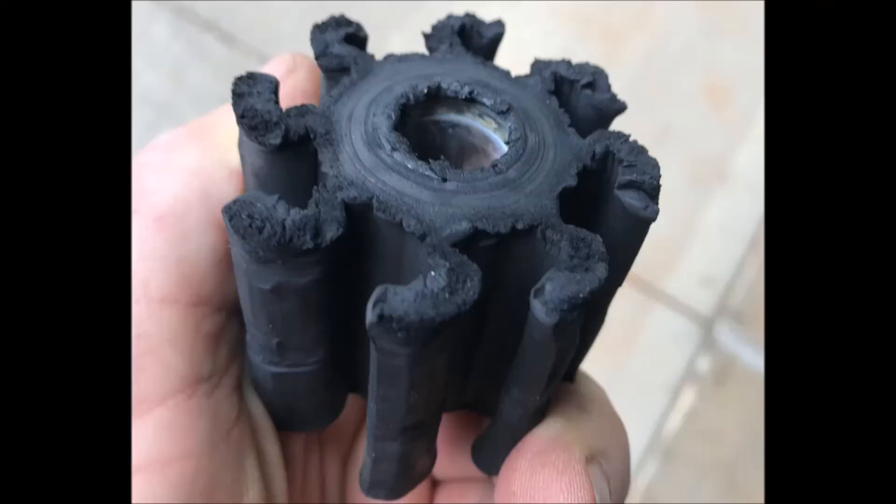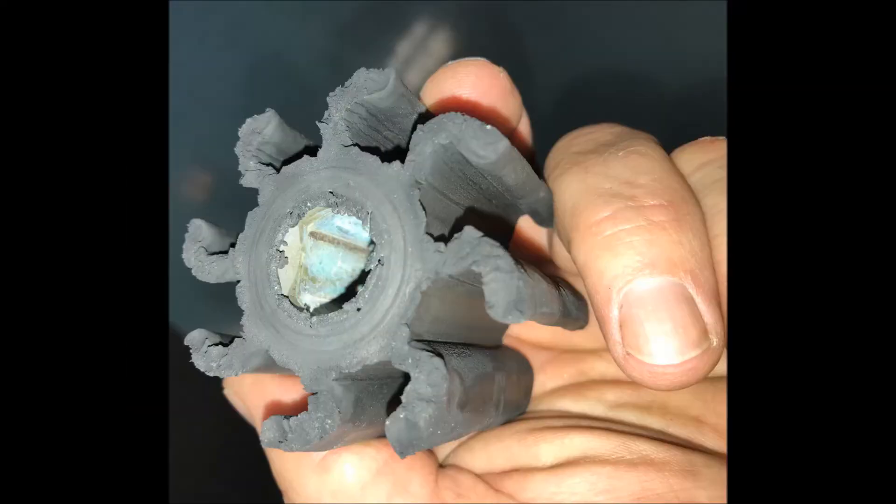Because of the situation that occurred in 2015, I decided I was going to replace the water pump impellers every five years. You'll see that the water pump impeller was removed this year as part of my five-year plan, and you'll see degradation of that impeller that occurred because of heat buildup. I never ran this engine without water running through the coolant system — I always had a hose hooked up or I had it in the water. So you'll see that over time, heat continues to build up and will cause damage to the water pump impeller.